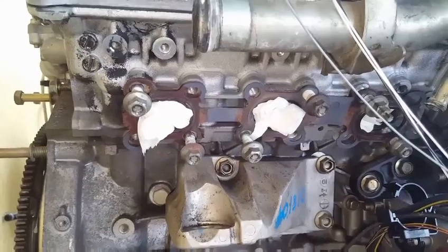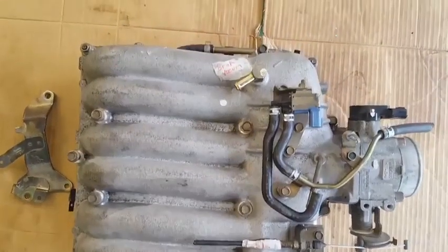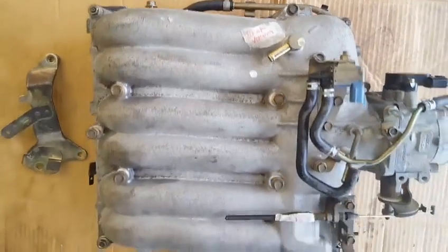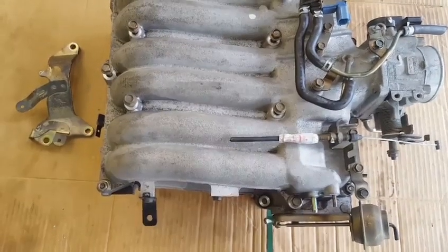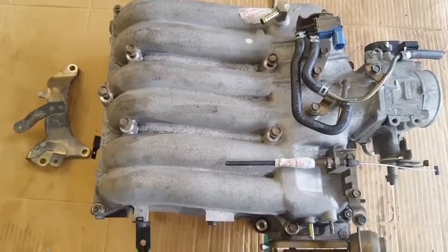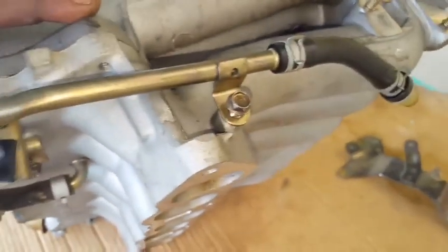At this point, we will reassemble the intake plenum upper and lower half together, placing all the nuts and bolts in position to prevent loss of those fasteners and refresh the memory of the location for proper bolt installation. We must also never forget these two 10 millimeter bolts for the PCV valve tube that connects under.